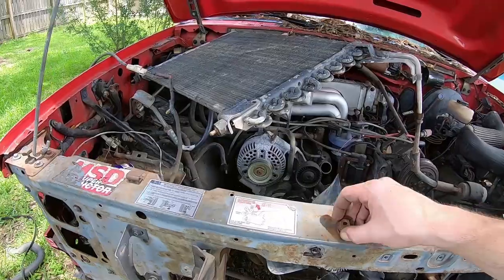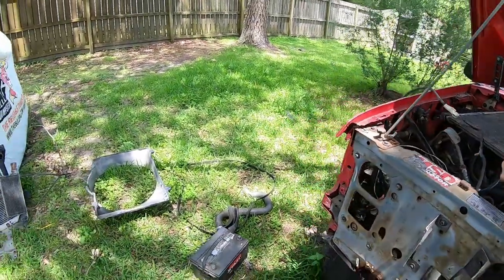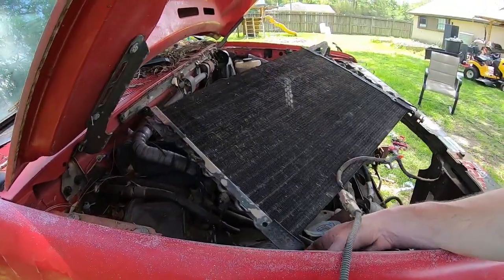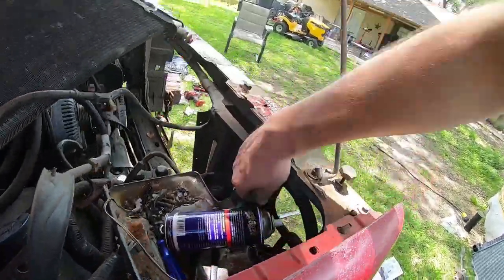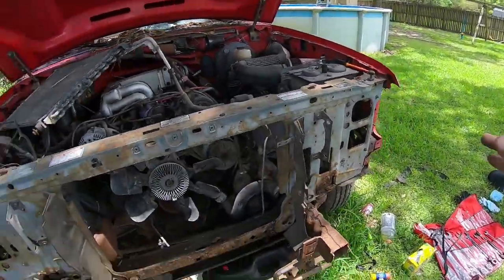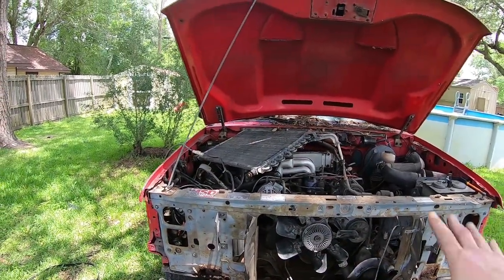Looking now, we are basically ready to get this core support out. I do have an issue because the hood latch is pinned to that corner - if I remove that bracket, I'm going to basically have nothing to support the hood with. Behind here, this is the wiring harness that we're going to break loose. It is in there basically with Christmas tree clamps - there were six of them. We're just going to pop those out, it will free it up, it's pretty simple. Once that's done, we'll pop that out and we're going to go ahead and pull this hood.